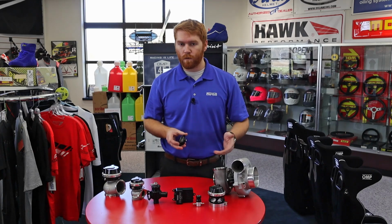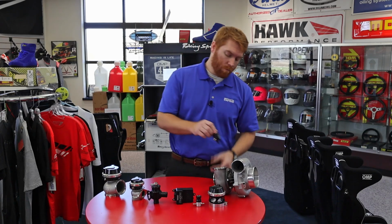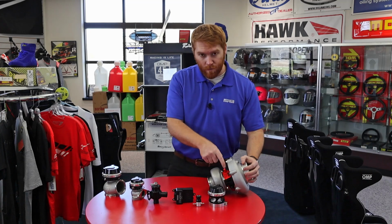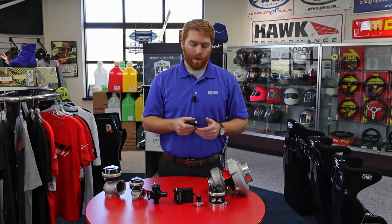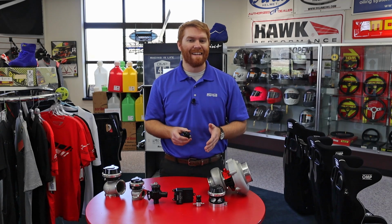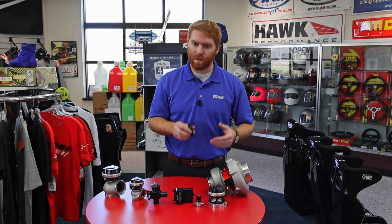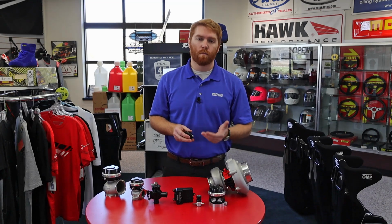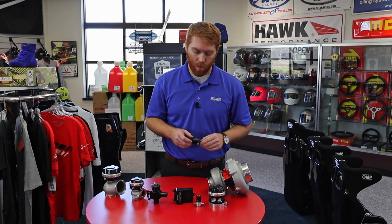Additionally, the other circuit that's really important with turbos is oiling. TurboSmart has an oil pressure regulator. This would thread into the inlet port. This is the inlet port. It's designed to keep a steady oil pressure. Turbos don't need 100 psi of oil pressure, but they need more than 10. So you really need to make sure that you have good oil pressure going into that feed, but you don't necessarily always need this massive influx of oil. A little bit of oil is all it needs, just proper oil pressure, but maintaining that pressure is really critical to making sure that the turbo stays happy and healthy.